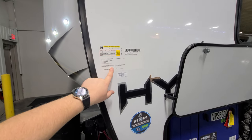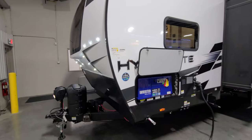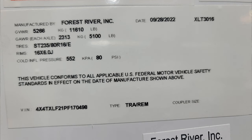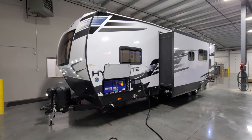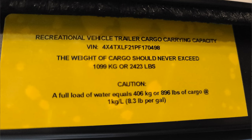There are important informational stickers here. The main production data sticker shows production date, VIN number, axle sizes, and most importantly the gross vehicle weight — the maximum you can load the RV. Next is the unloaded vehicle weight sticker showing how much it weighed off the factory line. Then there's the cargo carrying capacity sticker telling you how much gear you can load before exceeding the gross weight.